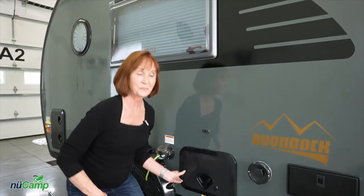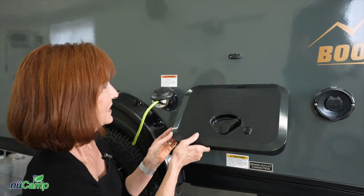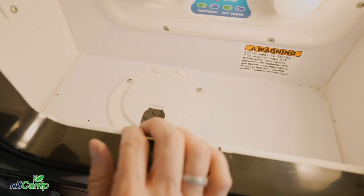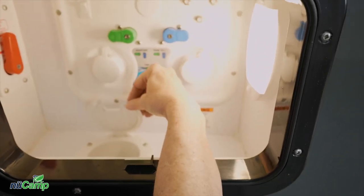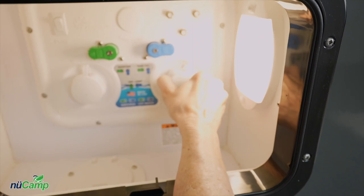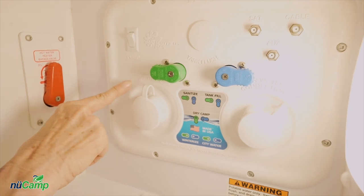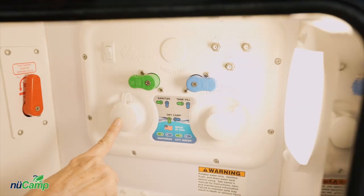Next is the Nautilus system. You will have a latch to hold the door secure and closed, and in 2022 they've added a lock. The magnet holds it open. Inside, to connect water to the hydrant at your campsite, you will run the water hose up through the bottom through this hatch — there's a slot that you can open so the hose goes right in and you can close the hatch over the hose. The hose will connect right here where it says 'water connection' — pull the cap off and connect it right there. There is a similar connection on the other side that says 'sanitize and winterize', so this right one is for connecting to the hydrant and the left one is for sanitizing your system or winterizing.